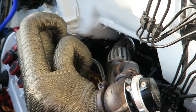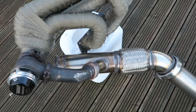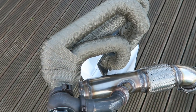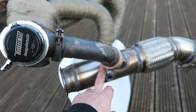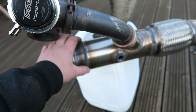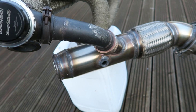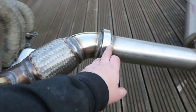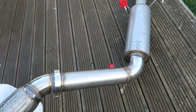So now I've got to get the exhaust off — it's all been done lovely, absolutely beautiful. I'm about to wrap the downpipe on the exhaust, but I thought before I do that I'll just talk you through the system. We've got the sidewinder manifold here — lovely bit of kit. I've got 45 going back into a three and a half inch system. We have got three here but it just flares up to three and a half to make sure it breathes nicely. I don't think I'll ever need more than three and a half. The system comes down here and obviously the catalytic converter will be going into this part of the exhaust. And then that's the back box there.